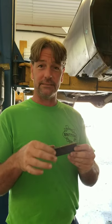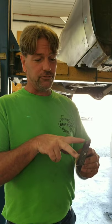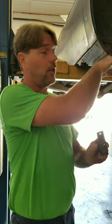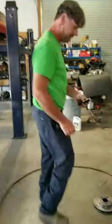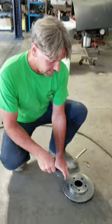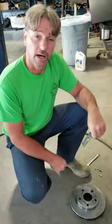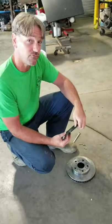However, you don't. You take a piece of angle iron, or it could be flat stock, it doesn't matter. Get your centerline right. Get your distance of the holes, because all the aftermarket Japanese rotors have screws that hold them on the hub. So we're going to use those to locate the centerline. Over here is the rotor. Here's the two holes we're talking about — that's usually to use a bolt to press them off the hub because they get rusted and locked on. Now I'm going to use them to locate the centerline.